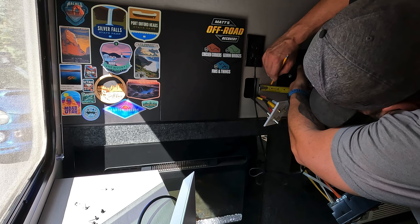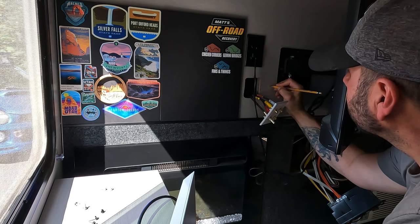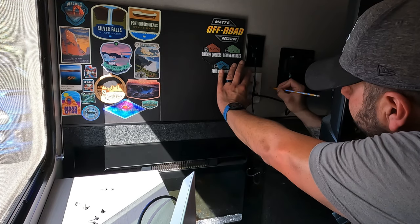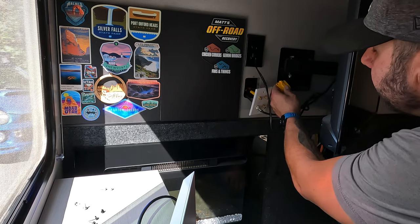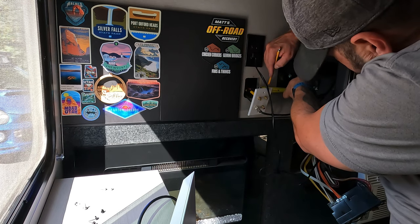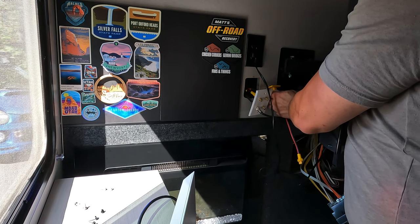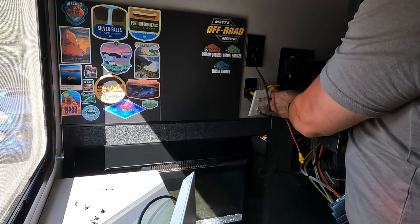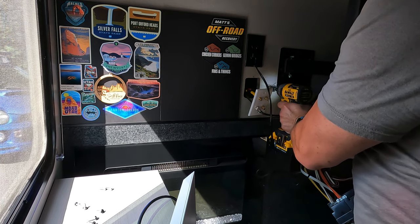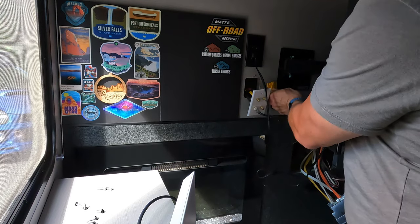The audio-visual jacks had been cut out right next to the one-by-one aluminum stud. I took that width plus half the width of the hole I was making to find my center, and eyeballed it level with the other outlet. I double-checked I'd be able to catch that stud with the screws that hold the jack. Measure twice, cut once — adjusted the measurement slightly, one more visual check, and it was time to drill. This is thin backer board, so I feathered the impact carefully to avoid making the hole too big or hitting any wiring. Quick fit check — that hole is done.